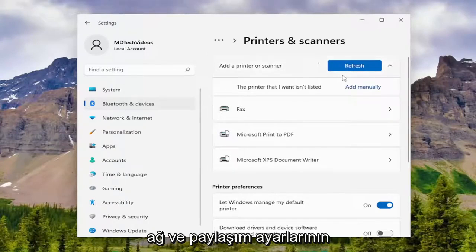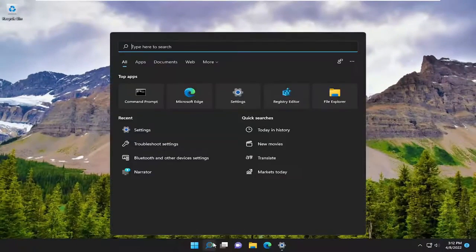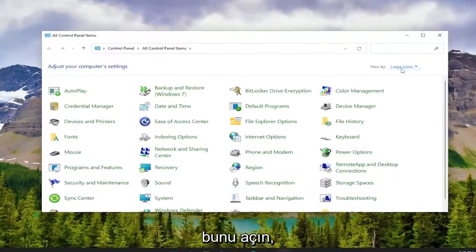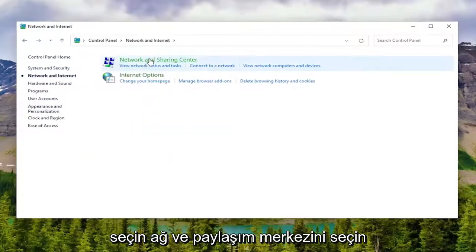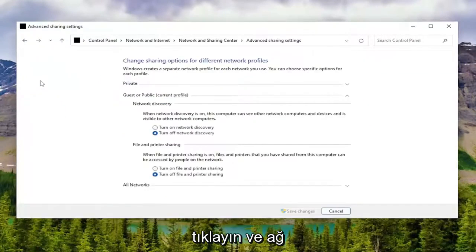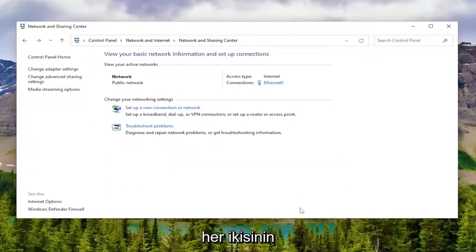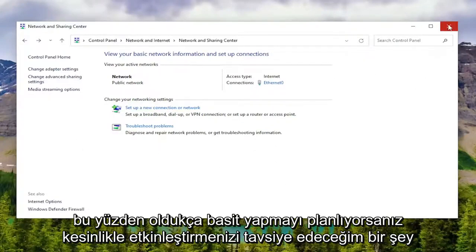You may also want to make sure your network and sharing settings are enabled on Windows as well. Minimize out of here, open up the search menu, type in Control Panel. Best match comes back with Control Panel, go ahead and open that up. Set your view by to category view and select Network and Internet, then select Network and Sharing Center. Where it says Change advanced sharing settings on the left side, left click on that. Make sure network discovery and file and printer sharing are both turned on, then select Save changes. That would be if you're using a wireless printer trying to share your printer with other computers on your network — definitely something I'd recommend enabling if you plan on doing so.